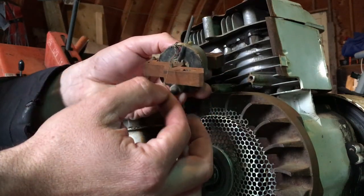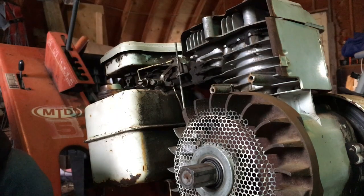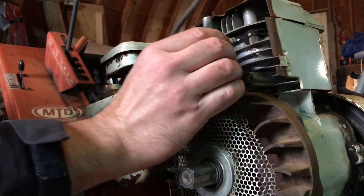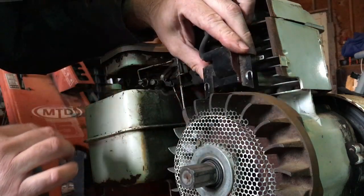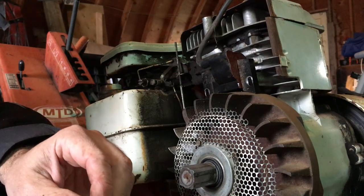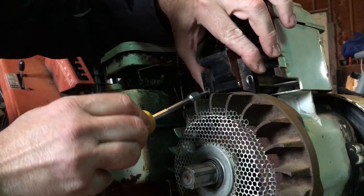Here's the coil that was on it. Apparently it's got this wire that went to ground and this wire that went to the points. It's actually quite loose in the cable, so if I ever need to restore it I've got enough pigtail to tie to it — but hopefully I won't need to because this new coil will work great. I'm guessing it should be fine and will line up to our mounting hole. One hole fits fine, but it looks like it might be a slightly bigger flywheel than this one, but for testing purposes we'll get it with one screw and see how it goes. If needed, we could epoxy it or come up with some mounting solution.